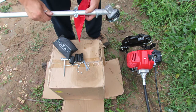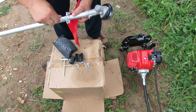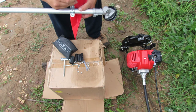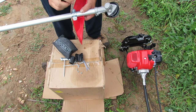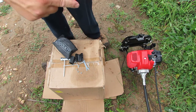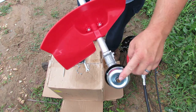That was the smaller of the two allen wrenches. Here's the larger allen wrench — we're going to need that to tighten these down. This did not have any loctite on the threads, so I'm afraid it's probably going to loosen up later. I'm just going to eyeball it to get this thing squared up. I guessed on the distance from the center of the shaft to the edge of the guard.